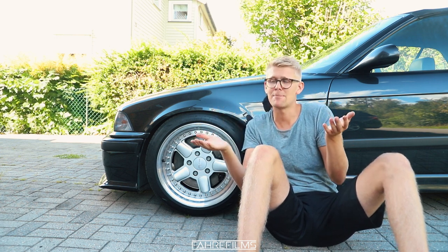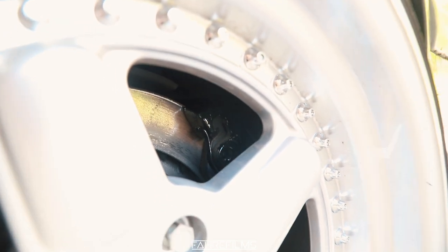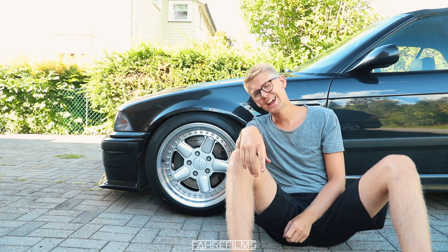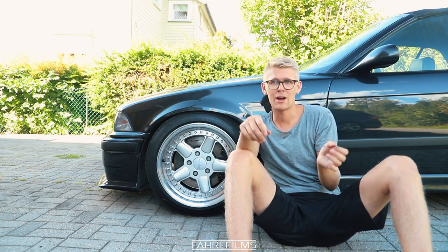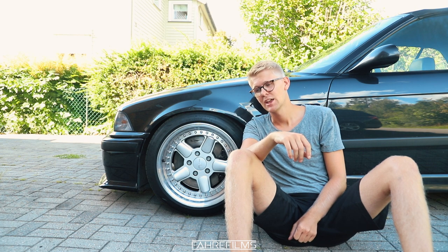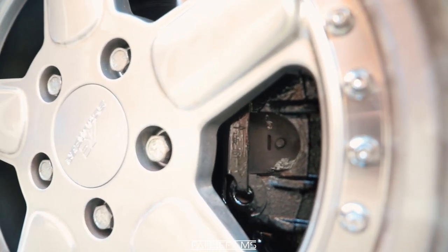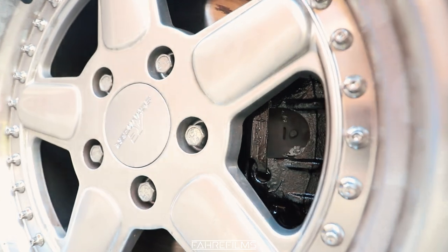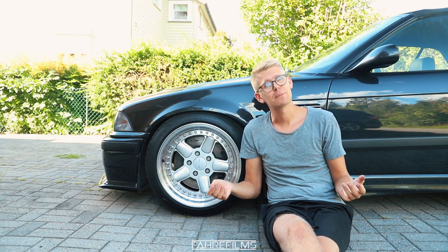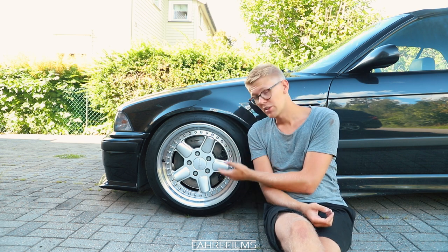To sum up: the amount of time used versus the look we got, I am happy with the results. But I will conclude that using a brush works, though I think taking your time to tape around it and use spray paint is actually better — the finish is thinner. On my 325 cabriolet a few years back it looked maybe even better, but that could be better prep work or better caliper condition. It's often very hard to see on camera how it actually looks in reality.